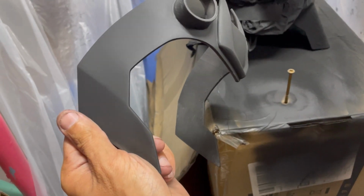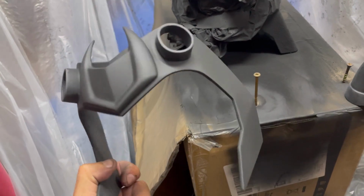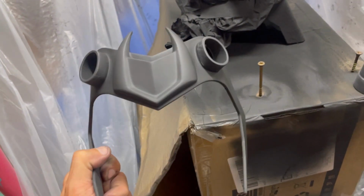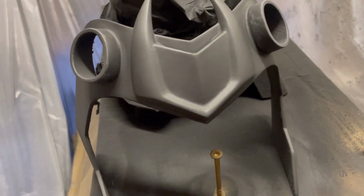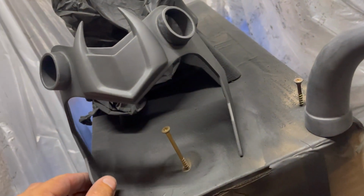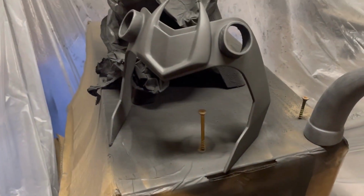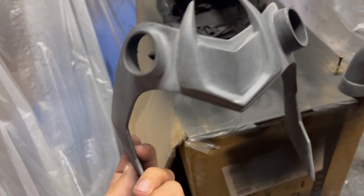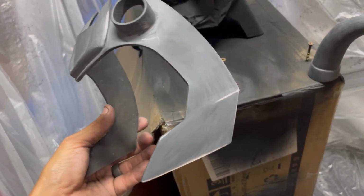After the crown was sanded and wiped down, I did 2 to 3 coats of Bondo filler primer. So you can see here, the crown is looking very smooth, very nice. I would then resand this whole crown with 320. Again, we don't want to use the same sandpaper because we don't want to delete all of our work. So going up to 320 basically allows the filler primer to fill in those lines. And here's how that crown looks after sanding with 320.